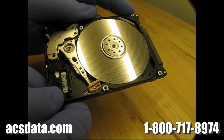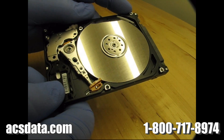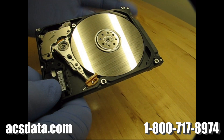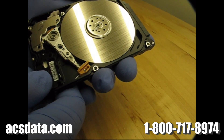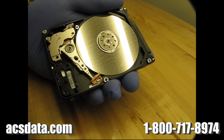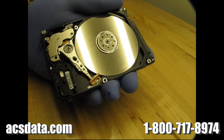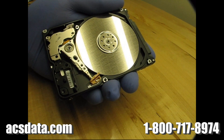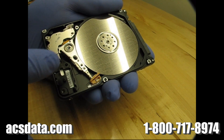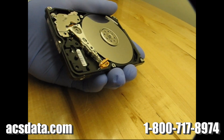So you would really need to weigh out whether the data is worth that chance or not. Again, these are not instructional videos. This is more just to highlight what it is we do and give you an example of some actual cases that we work with. We'll go through now and put this drive on our imager and see if it works. A lot of times when we have an issue like this where heads have landed on the platter, we at least lose one — sometimes multiple heads. It may not even calibrate and become ready. It won't surprise me a single bit if it doesn't. These heads are extremely fragile and it's nothing for them to actually come completely loose from the base that they're attached to.